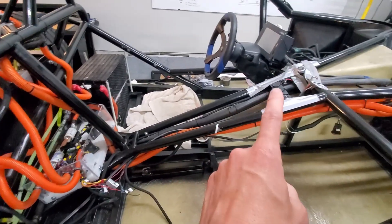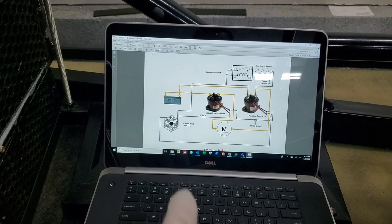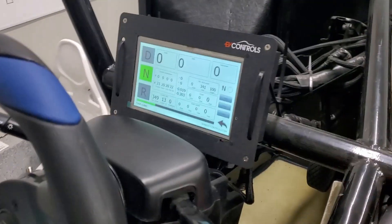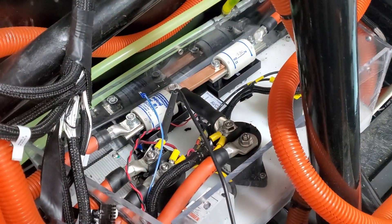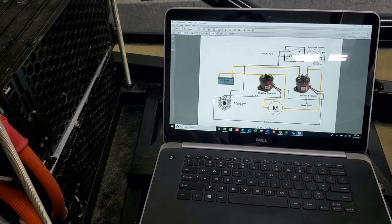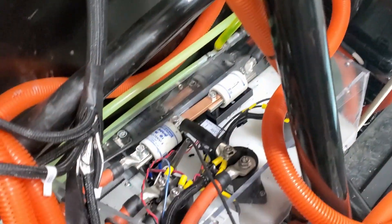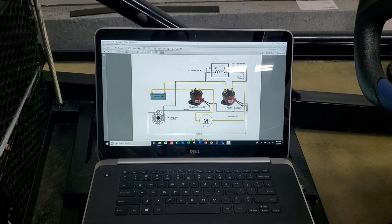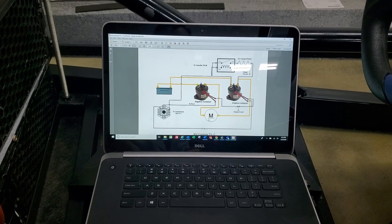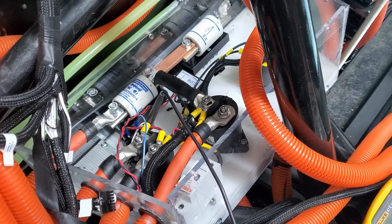Getting back to that system cycling and clicking on and off — I disconnected relay 86, pin M, and that broke the cycle and it seemed to fire up fine. Which is interesting because I don't think this thing should start without that, so it makes me wonder if the relay is bad. I turned it off, plugged it back in, and now it seems to have started up fine. I'll relay this information to EV controls and see if they have any thoughts. It just seems like something was in a loop it couldn't get out of — a relay loop or contactor loop or something out of sequence. Now we're good.